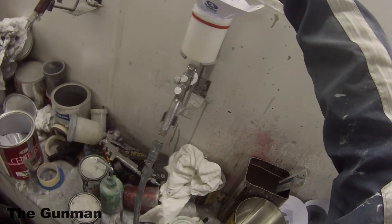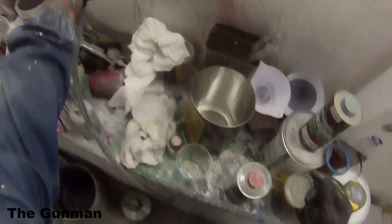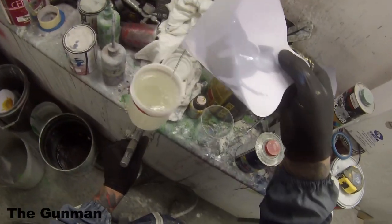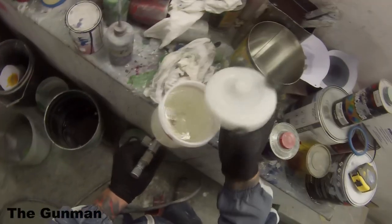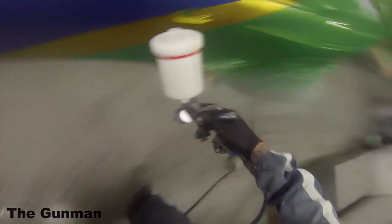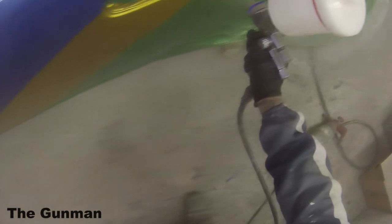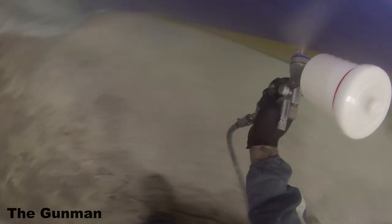I used both of those clears at a BMW shop that I worked at, and the shop ran an entire Glasurit system unbastardized, so they didn't use any inferior primers, anything that didn't have the Glasurit stamp on it. And I still remember back in those days, they were some of the best paint jobs I've ever done. It was a different booth to this. It was a water floor booth, full downdraft system. It had the sticky booth coating, Pro Cabin, on the walls, which is actually where I got onto that booth coating, and it's great. I will go further into detail on spray booths in a separate video.